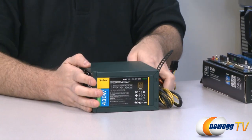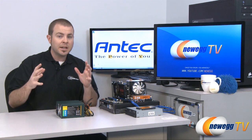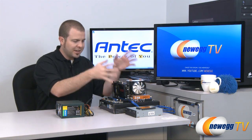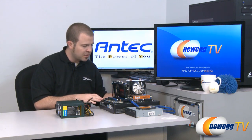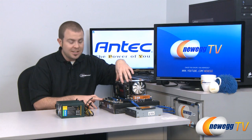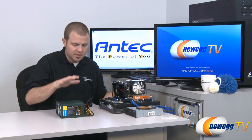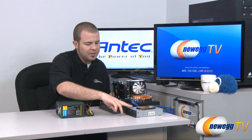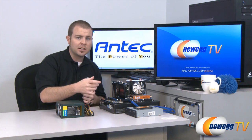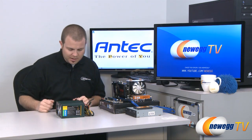This is an EarthWatts power supply meant to be eco-friendly, and if you're purchasing this type of power supply you're probably interested in what actual wattage savings you might get. So I'm going to plug this into our test setup, which has a P67-based motherboard, an Intel Core i5-2500K CPU, an Asus GTX 550 Ti video card — which recommends a 400 watt minimum power supply — a Blu-ray drive used to load the operating system, and a single SSD. The only thing really missing power-wise from a full computer is possibly a magnetic hard drive, which usually only uses about 10 to 15 watts under load. We have a watt meter on the wall, so we're going to see how much power it draws at idle and then under a simple benchmark.